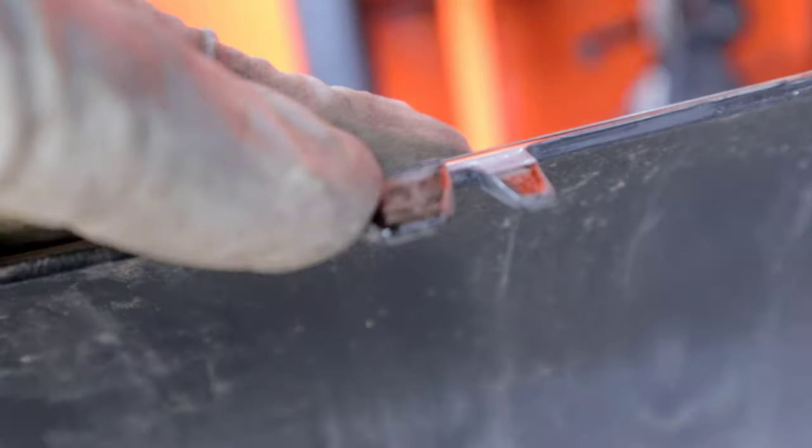I'm gonna have to see if I can get that figured out, and I'll let you guys know if I can. But for now, I'm gonna go ahead and put this on the bumper and install it back on the car. This is a little close-up of that little badge. As you guys can see, there's little clips here on the back and two tabs that you need to push in so that you can pop out this SRT logo. So I'm gonna go ahead and do that now. To install this upper grille, what you need to do first is install the bottom portion of it and then the top. I'm gonna go ahead and do that now here.